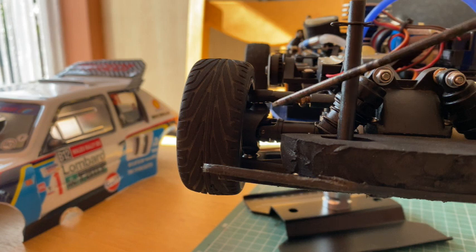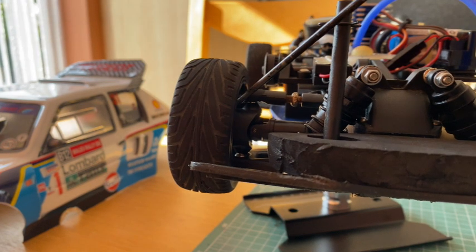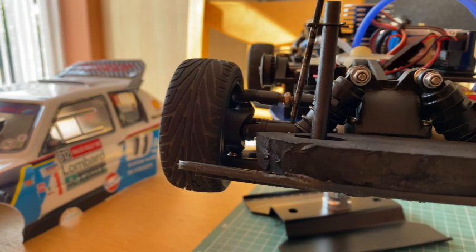These hubs run two bearings. Hands up - I forgot the inner bearing. There may have been a reason I overlooked it, but basically the inner bearing didn't fit; it wouldn't push in hard enough. I'm guessing maybe I was going to look at it and forgot. Whoever had the car before clearly ran it without a bearing, which put a heavy lot of strain on this drive shaft.